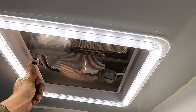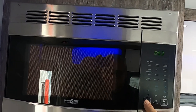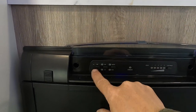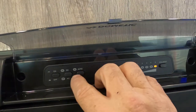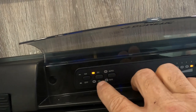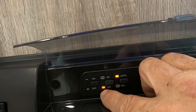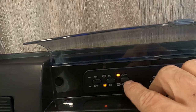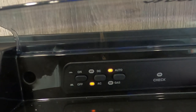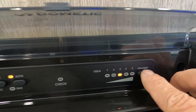Coming into your shower and bathroom, you've got a hand-crank exhaust vent, a protective guard for your TP, and lighting. There's a microwave. The fridge is automatic — flip this up to turn it on, and we're going to put this on auto. Auto means when you're plugged in you're running off electricity; as soon as you unplug, it switches over to gas. You can also run it on 12-volt DC, but auto is best. When that light comes on, you're running off gas — check your gas level. The temperature dial goes one through five, with five being the coldest.